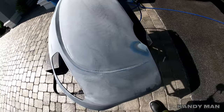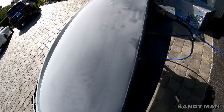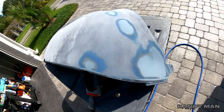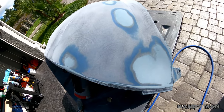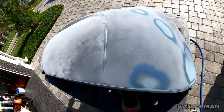Then we'll move on to the body — that's going to need primer because it had a couple more gouges than this did. Let's get this scuffed out and move on. The good thing about this is these are the same steps you would do on a car, so if you've got something small you want to try painting, follow this through — it's the same process.